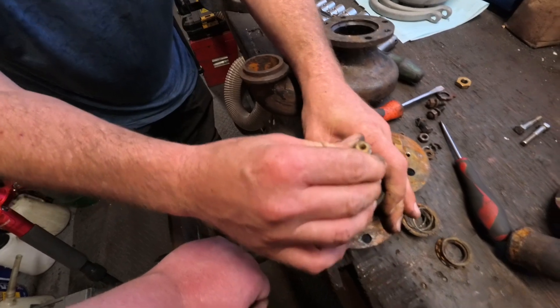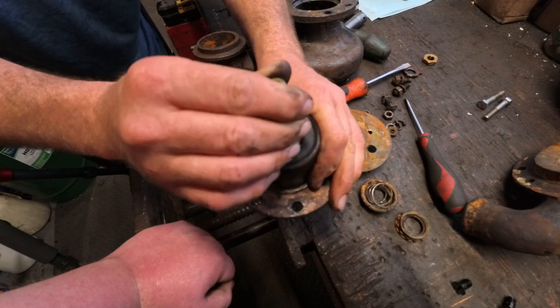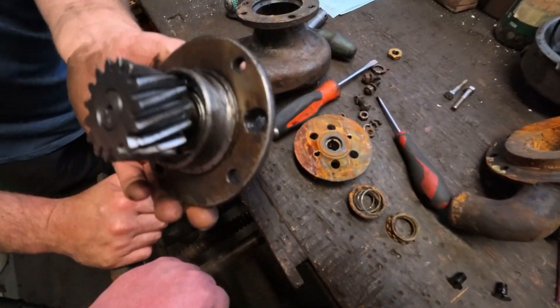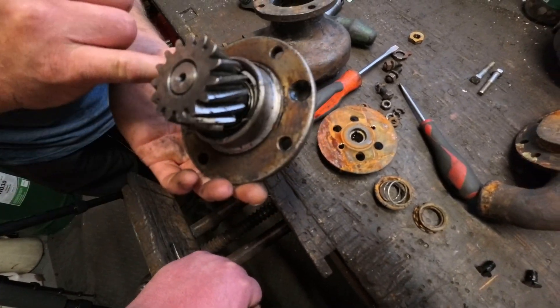Not only is it like that, but it's also got acres of play that way as well - there's plenty of play that way. So I'll knock the bearings out, find the new bearings and see if they're available. So you take that circlip off and you'll be able to knock the whole lot out downwards.